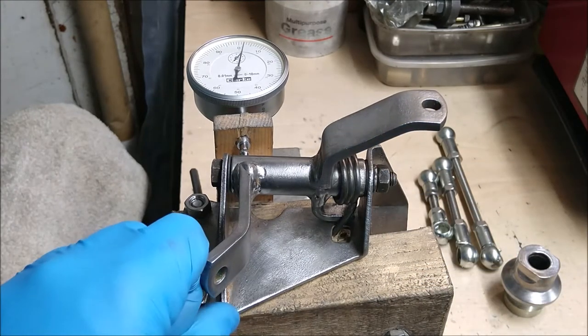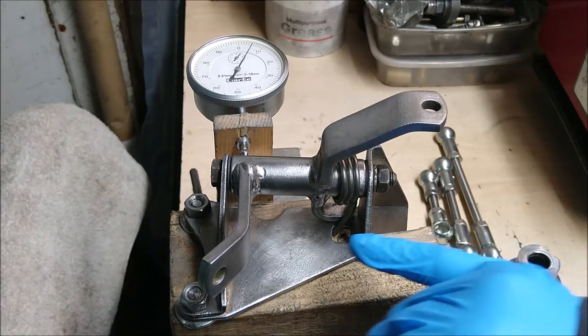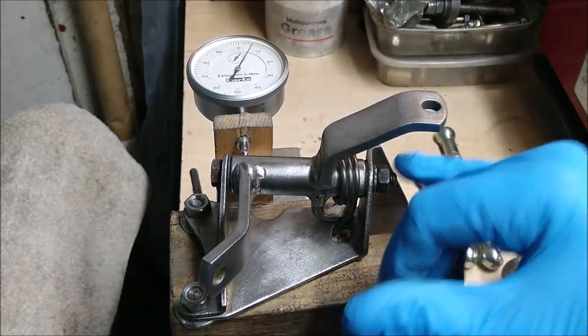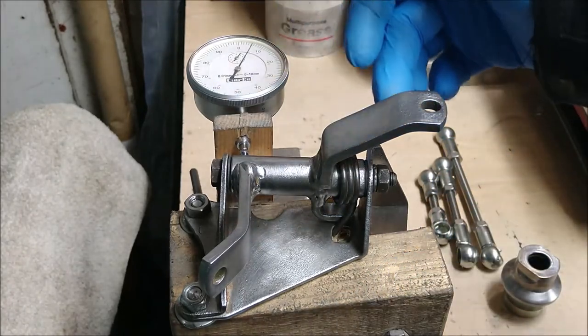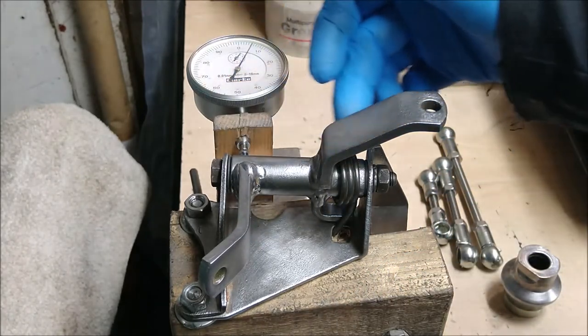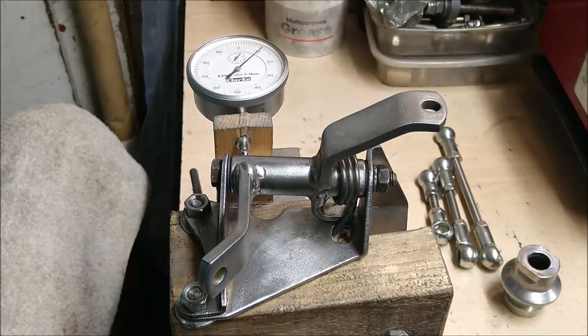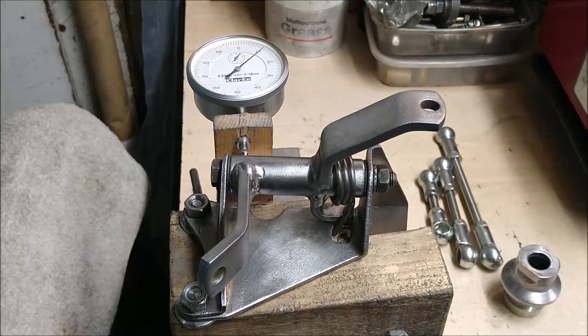This is an early one where it tends to wear in the base plate — the holes where the bolt goes through go oval and misshapen. The original has a shaft going through the middle but only two bearing surfaces, one at each end, nylon bearing surfaces, and the holes obviously wear quite badly as well.